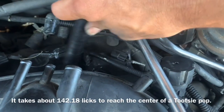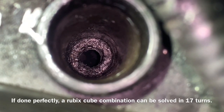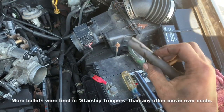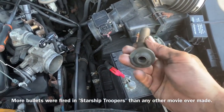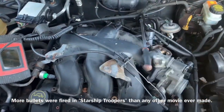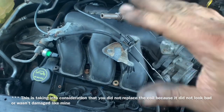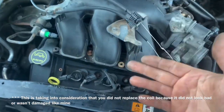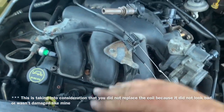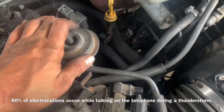Eureka — new threads are installed! We need to do a little more cleaning inside there, but it's looking good. I'm going to get a new spark plug boot, new coil, and new spark plug, put those in, and see how she goes once we get the intake back together. If you have doubts about a rear coil after the blow-out, you can always swap one of the easy-to-reach front coils into the back to test.